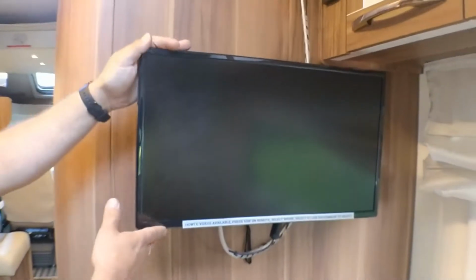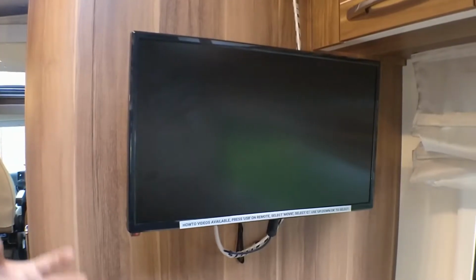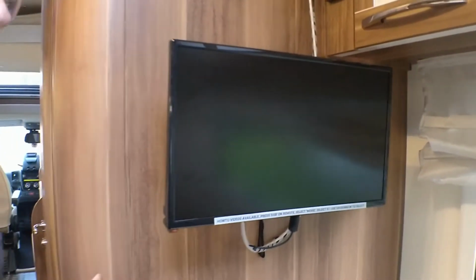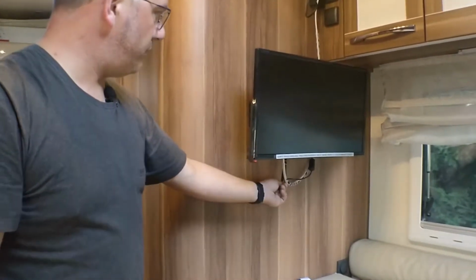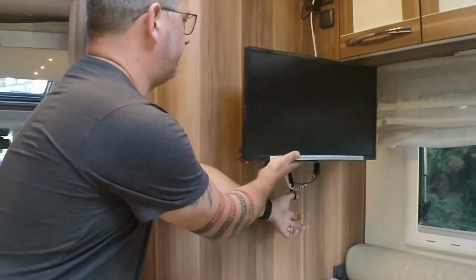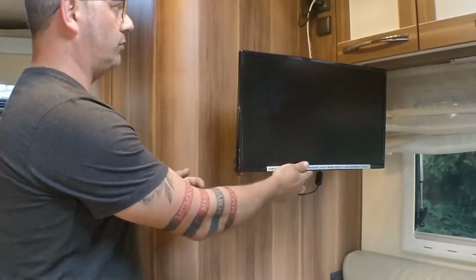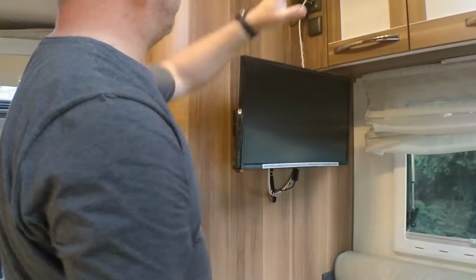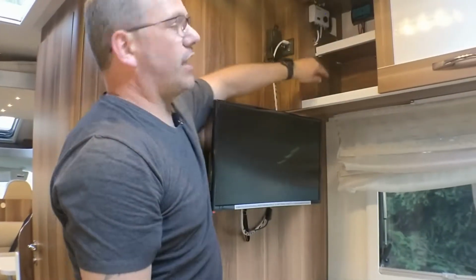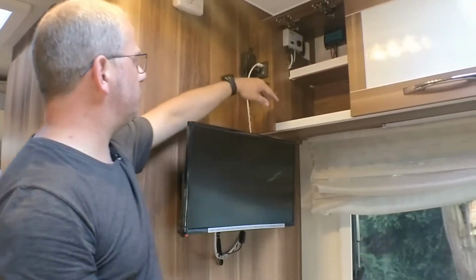Moving to the back of this van, this is where the TV, DVD, combi video is. It works off 12 volts and an aerial. Depending where you are in the country, you've probably got to retune it to get anything. You'll also notice that they all have this little ribbon underneath. Just pull that and you can pull the TV video out and move it to a more comfortable position. Ensure you clip it back before you drive off. The other thing is the remotes get hidden everywhere, so just have a little scout round the cupboards to make sure they're working.